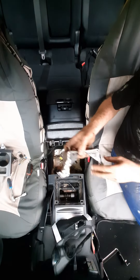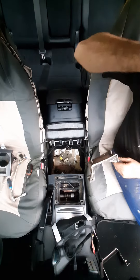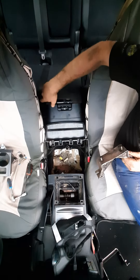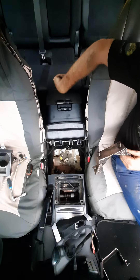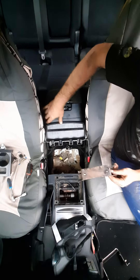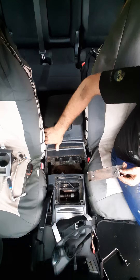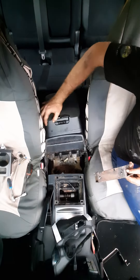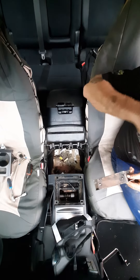If you've done the dash and you're still struggling with your Pajero's center console being a rattle box, especially with this top one — that'll get some foam — but definitely this bracket should remove some of that. If you punch it on the side once it's in, you'll see it moves around quite a lot.